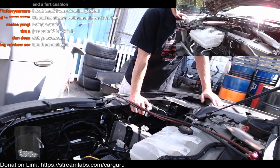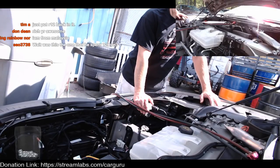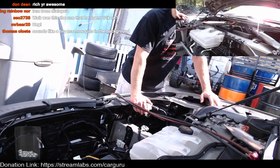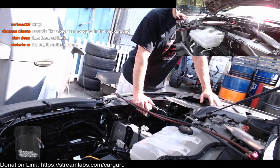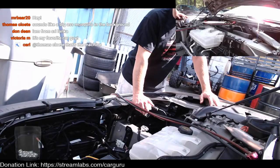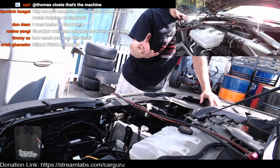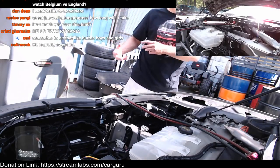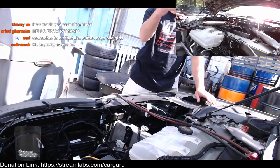And if we want to, we can actually vacuum it down. Let's say we service it, we can vacuum it down and make sure the system holds under vacuum so there are no other leaks. But let's say we had it open, it'll also get moisture in it. The AC system has a desiccant bag in it that's hygroscopic. It absorbs moisture. We want to get that moisture out, and to do that you apply a vacuum. Water will start boiling at a low vacuum. When people think boiling, it has to heat up, but it doesn't. When water's under vacuum, it'll vaporize and come out. You get all the water out of the system. When you have the system open, you don't want water in there when it starts working. You start having ice crystals going places and clogging up. Not cool.